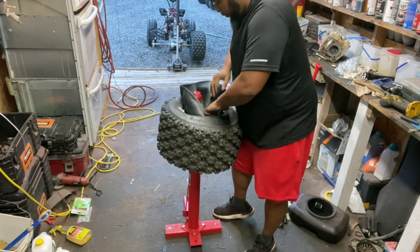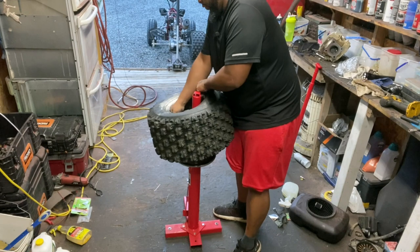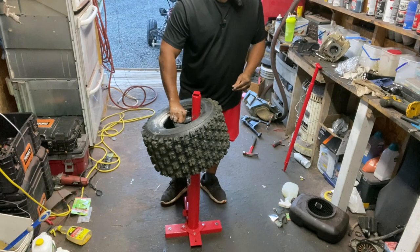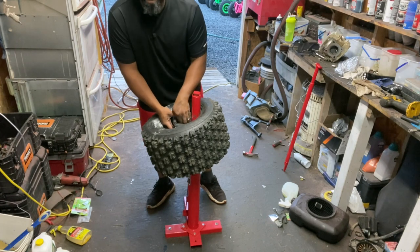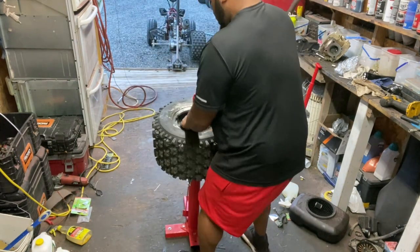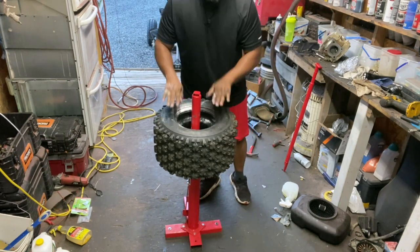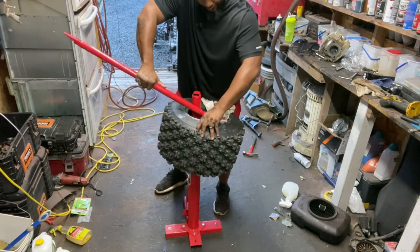So now I'm just doing a voiceover to try to sync up the same information. The important thing right here is to make sure that you install the tube in a direction that gets the valve stem where it should be. I'm just stuffing it around the corners and making sure I can line the valve stem up so it can come through and be where it should be. Another thing to know is that tube valve stems are a little different than the standard valve stems you can buy from the store. Standard ones are rubber and you kind of pull and pop those into place, while tube valve stems go in and have two locking securing nuts to hold them in place. We need to make sure we get at least one of those on there, because it can move while you're inflating the tube — and we want the valve stem to stay exactly where it is.